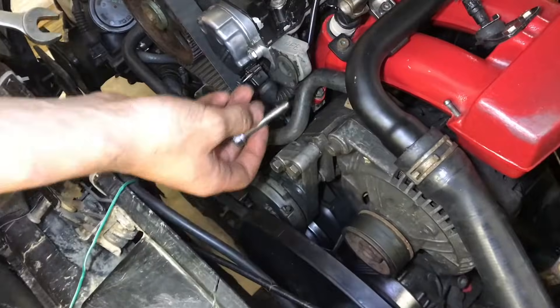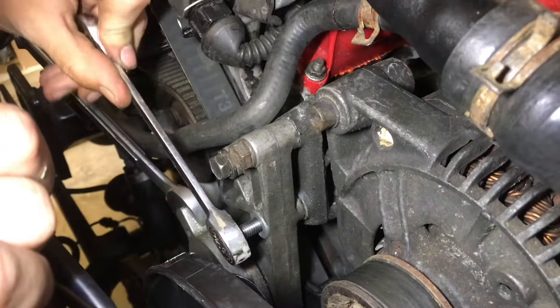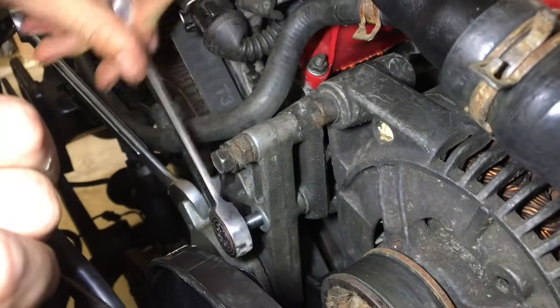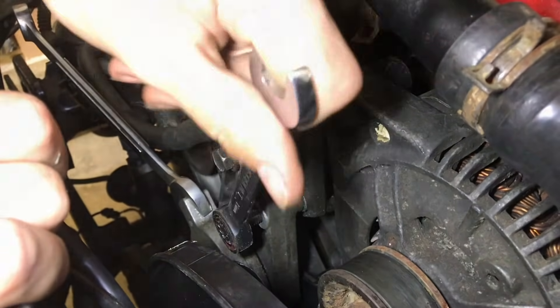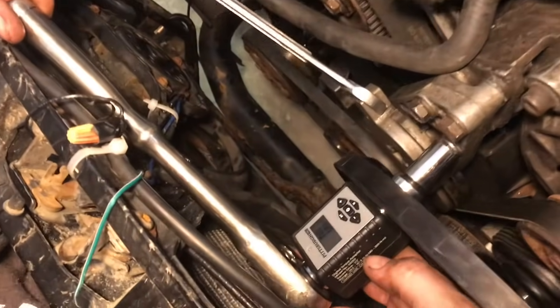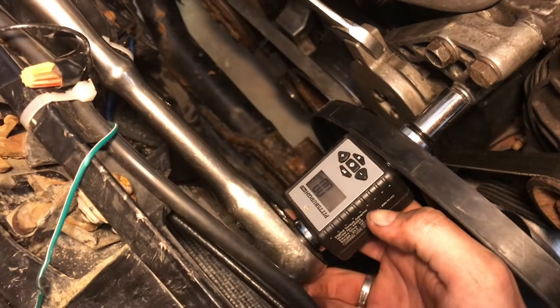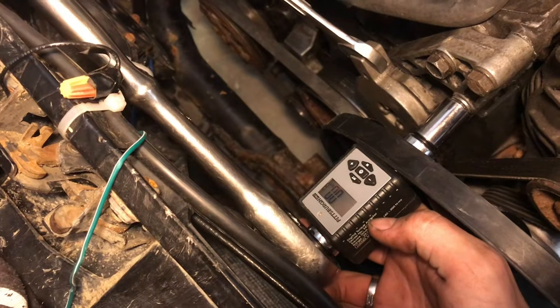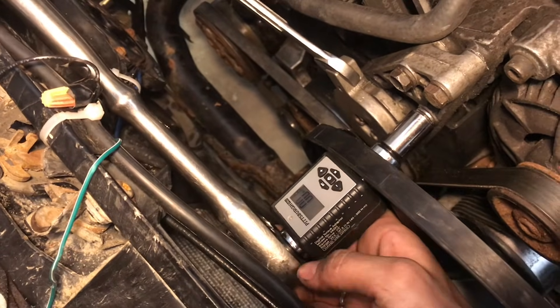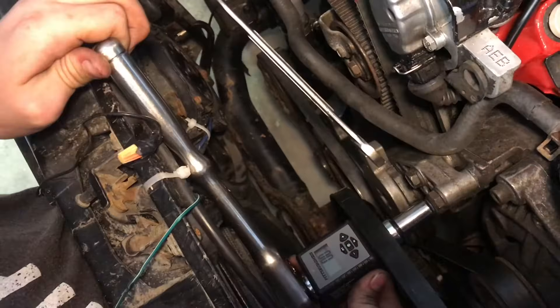It's been 24 hours plus so we can go ahead and torque this into place. It feels like it's going in nicely but the true test will be whenever we put torque on the bolt. The torque spec on this bolt is 18 foot-pounds, so hopefully we'll be able to get that high. I'm gonna use this electronic torque wrench so we can see exactly at what point it will fail. If it gets up to 18 foot-pounds I'll stop, but if it starts slipping anywhere in between I'll stop there and we can take a look at where it failed.